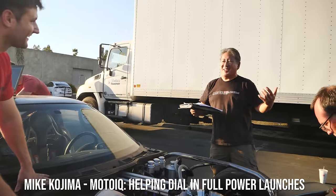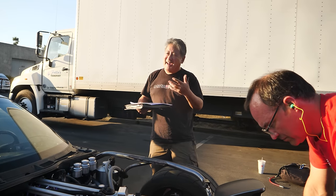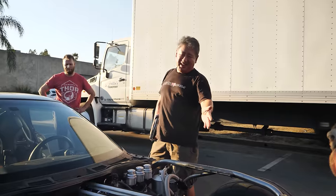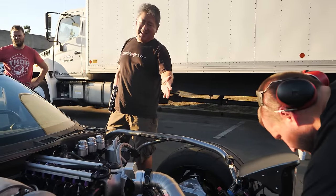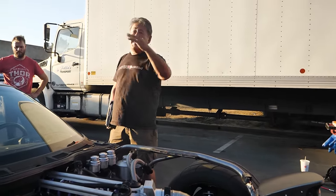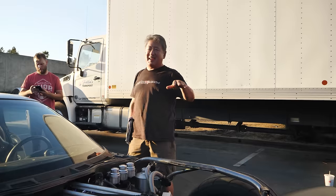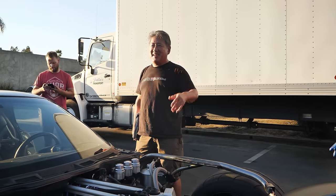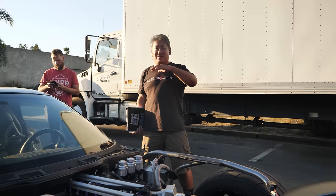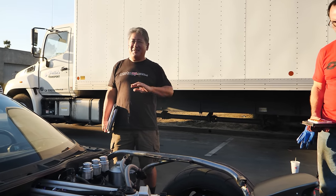What are you thinking? Each knob could be like three different things. Yeah. And there's no set pattern to it. So we might not even know what we're adjusting. Pretty light on the rebound and medium in the compression in the front. Okay. And that's going to help the car. That really helped the GTR. And then the rebound control actually kind of helps with wheel hop and tire wind up. So what I want to do is put the very like what we did with the GTR in here, at least for our initial.